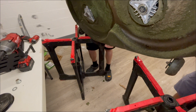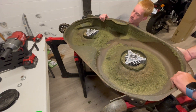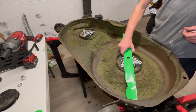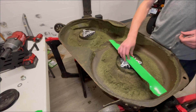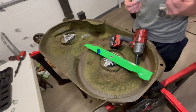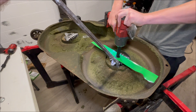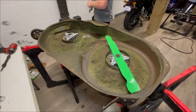Time to flip it over and install those blades. Probably should have cleaned up the deck before doing this — should have taken it outside and pressure washed it. But here we are with the blades. Grass side — it's pretty clear where it goes, with the splines to line it up. There's a tool to secure the blade into position when tightening the bolt, but I don't have that, so we're using a crowbar, just wedging it in there to hold that blade in position while tightening.